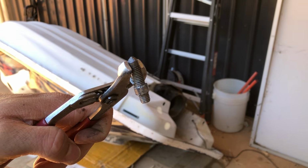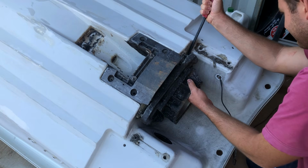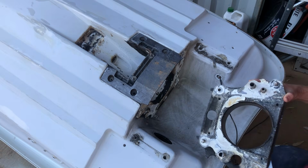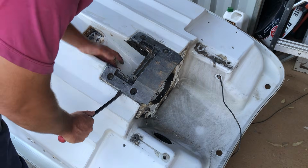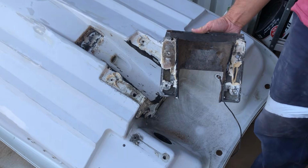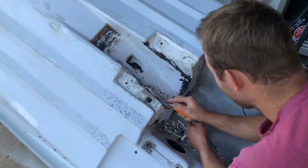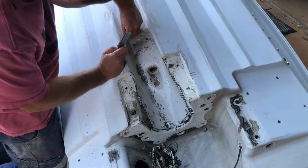With the fastener out the way, the only thing holding it on now is that super strong adhesive, but now with good access and the ski upside down, I can just pry it off. If you're concerned about any gouging from the tool, don't worry, that'll all get addressed and filled properly at this stage anyway. Now with that out the way, there's a lot of cleanup to do in these intricate areas that you can only do by hand, so it just took a bit of time.